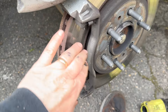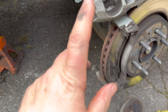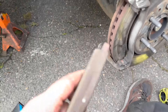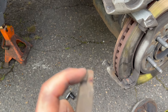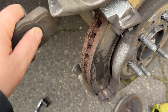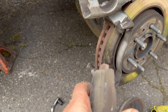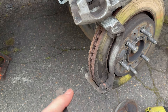That's why I'm going to replace the rotor. If you hit your brakes and hear a grinding metal-to-metal noise, you have to go outside and look — I'll show you one so you can see the difference. You can see metal-to-metal. What that means is the braking material went all the way down to nothing and the backing plate is metal. So that's the scraping noise you're hearing. Once that happens, you have to replace the rotor — it's already gone. Don't cut them, just replace them. Because if they're warped and you hit the brakes and it starts pulsating, they're already warped from being thin. When you cut them, they're going to warp faster.